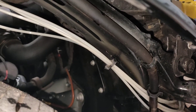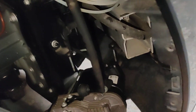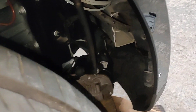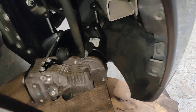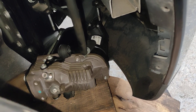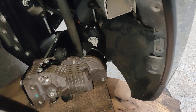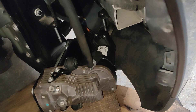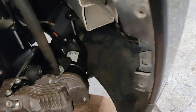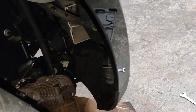So today I'm just checking the control side from the computer to the compressor. Last week, as I showed in that video, every time the compressor came on, the computer would cut it out because the current draw is so high. It cuts the whole system out and the engine turns off, because the relay is part of the airmatic system. So I've disconnected the pressure sensor side.